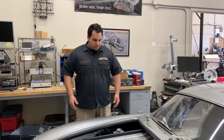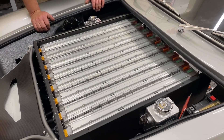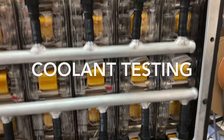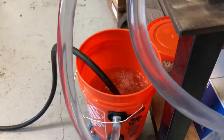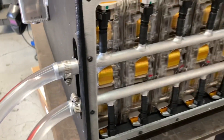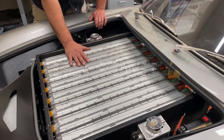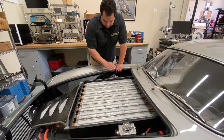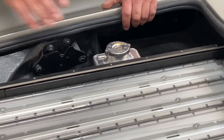So since the last time there was nothing in this car, now we have a complete battery pack. We have water cooling on all of the modules in here. There are eight modules up here, four below it, and three behind that in the back. We have a separate water cooling system for the batteries and for the charger.